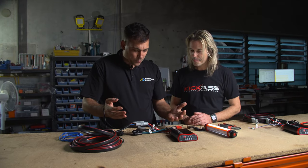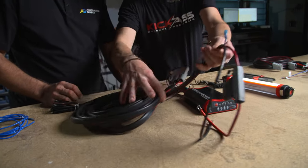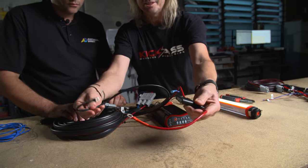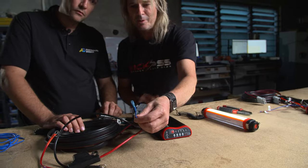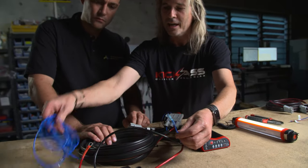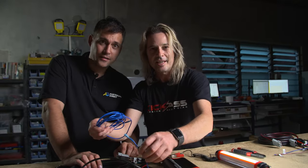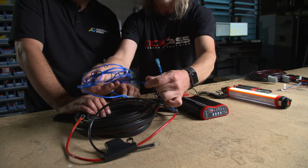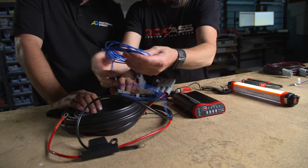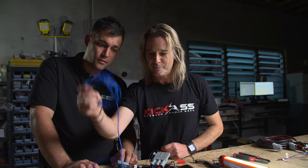So what's the difference when you wire it up, Craig? The main difference is up this end, which is the real biggie. Underneath your bonnet, you'd normally go to your battery. We've got your fuse, and then there's a little wire ready and waiting for you. We give you a little bit of extra wire — that's what you need to tap into your vehicle's ignition-on or engine-on signal. Something like the car's fuel pump relay, or anything that's hot or 12 volt when the engine is on. We've given you everything to connect it up. If you can't find it, just go to your auto — they're not going to charge a fortune to put in one wire, but we've done it all for you.